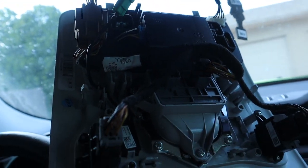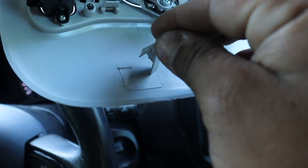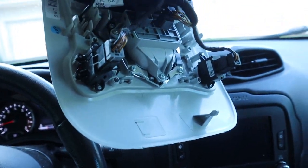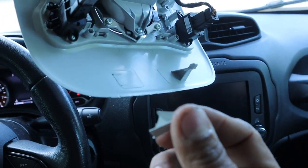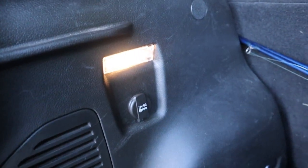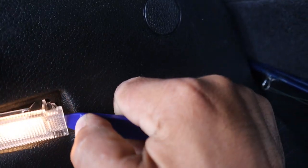I did have a little misfortune when I pulled this piece off - something broke. So I'm just gonna super glue the crap out of it and hopefully it'll stick. I don't ever see myself pulling this back down for any reason, so as long as I don't have a nasty gap up there, that's fine. Moving on to the back side of the car - you can see these already have that ugly yellow again, same on the other side. These are actually a lot easier to take off. Grab your panel removing tool from the end here and pry it towards you - it should come straight out.